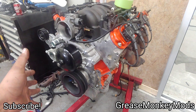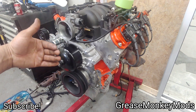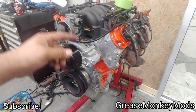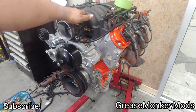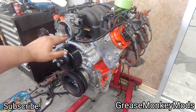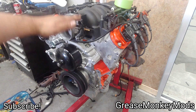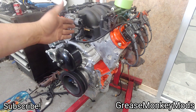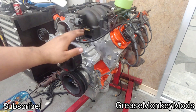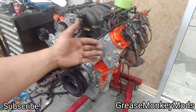Truck stuff is just really far out there. It's really hard to get truck accessories to fit into a lot of swaps because it sticks so far out and hits the radiator or cooling fans. Another reason you might need LS1 accessories is if you have to run a car intake manifold, because with the truck water pump it actually sits higher and would interfere with the throttle body. If you need a car intake manifold to clear the hood, you need car accessories — you can't mix truck accessories with car ones because the pulley offset would be far off.